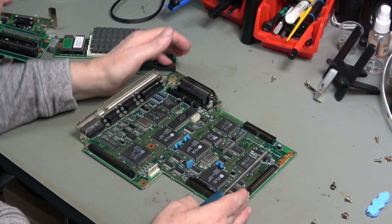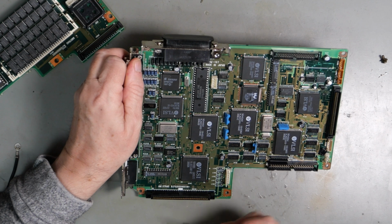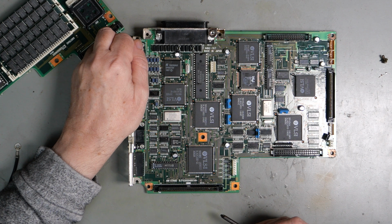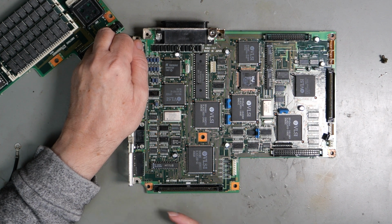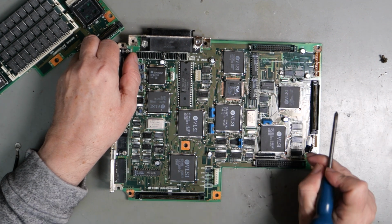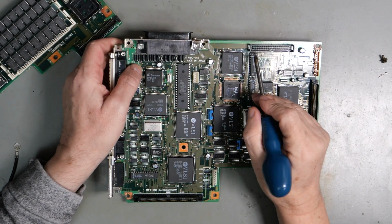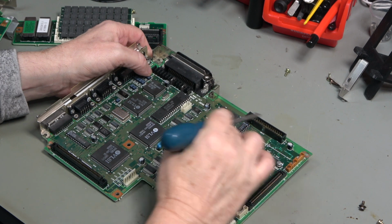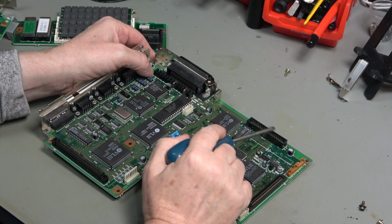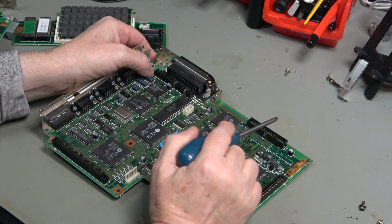And onto the main board. This area had the white fluffy mould stuff, and there is a little bit of corrosion right down the bottom. I've neutralized that again the best as I can. IPA, vinegar, all that stuff. And same here, round here, this is the bad stuff on the board. That connector I've cleaned. This connector I've cleaned the best as I can. There is corrosion down the bottom of it. That was close to the battery area. I'm suspicious that there might be some corrosion underneath it, so probably going to have to take that connector out and put a new one in.